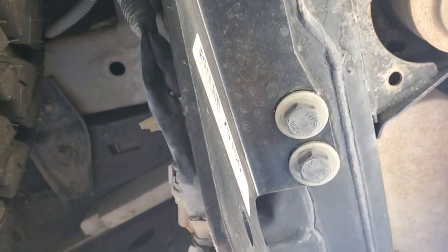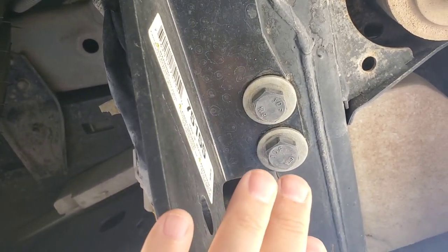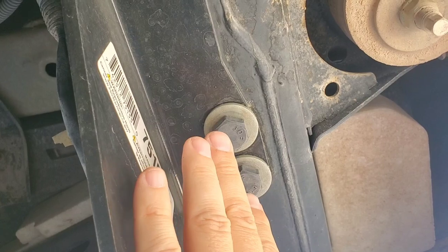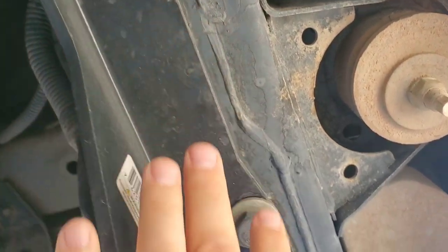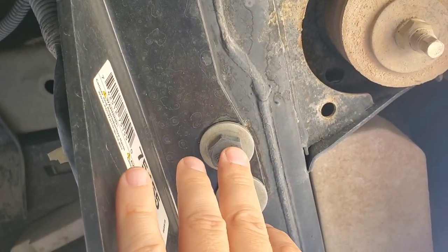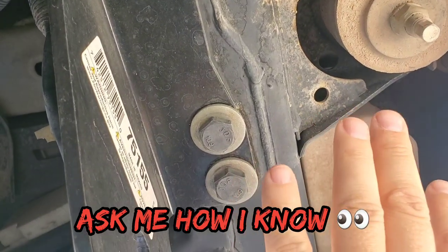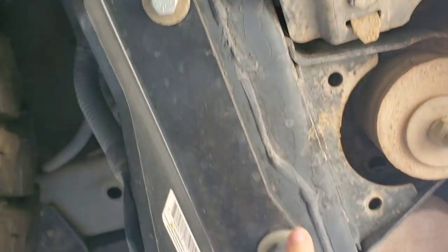If you're doing the frame-mount hitch setup, one thing that is absolutely critical: if there was nothing bolted to the holes in your frame, get an M12 by 1.25 millimeter thread tap and gently tap out these bolts — including the backing bolt — because if there's any rust or corrosion on those threads and you try to tighten the bolts down, you're going to break the captured nut out from inside the frame and it'll spin free. Make sure you tap all three mounting holes clear.